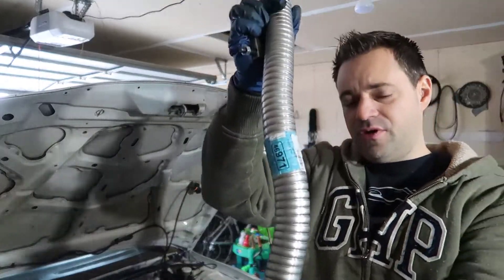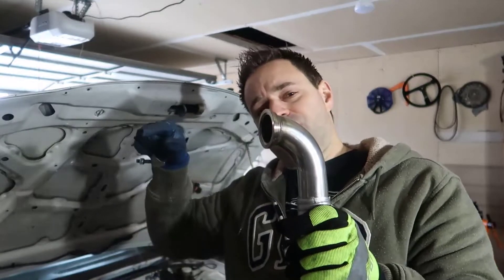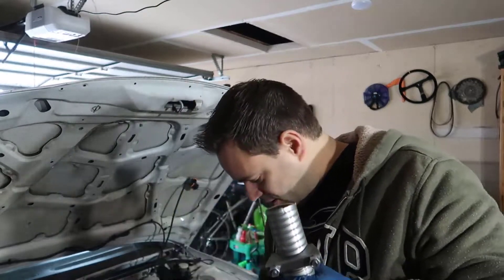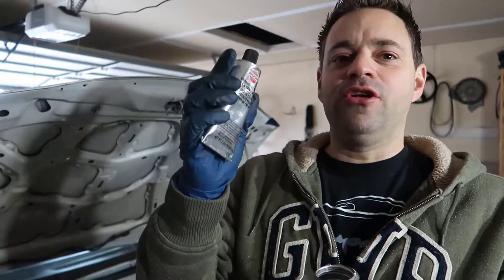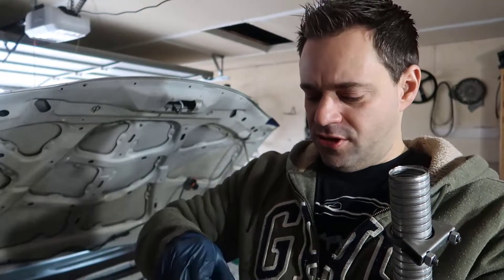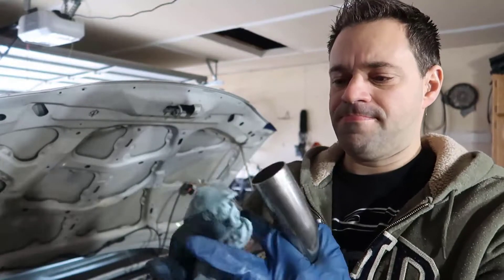I'm going to form this and put it down there. At the end I'm going to weld - or ask someone to weld - one of those fittings onto my exhaust pipe, which is going to be custom made, and then I can dump into there. First I'm going to slide the clamp all the way down so I have space. Now I'm going to apply this exhaust joint and crack sealer - I believe it will give us a good seal as it gets hot. I'll clean the surface and put a thick bead around it.